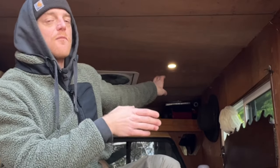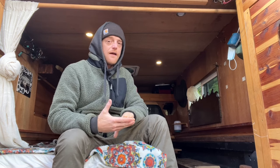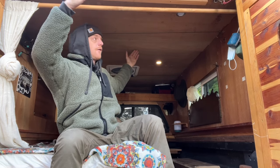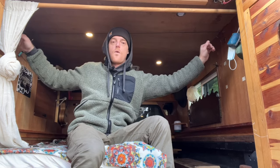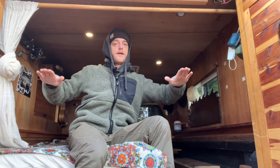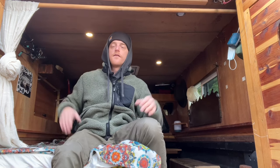I figured out the height I wanted, then looked at the length. My whole goal was to be able to fit an eight-foot-long board in the camper, because my bed is only six feet long and I need a little overhang in the front. Eight feet also happens to be the length of a plywood sheet — plywood comes in eight-by-four sheets — so I made the top eight feet long, doing two pieces of plywood side by side, four plus four totaling eight. For the width, I made it about as wide as the bed walls themselves, since the camper sits on the rails of the bed and is bolted through the top of the rails into the actual wall of the truck bed.